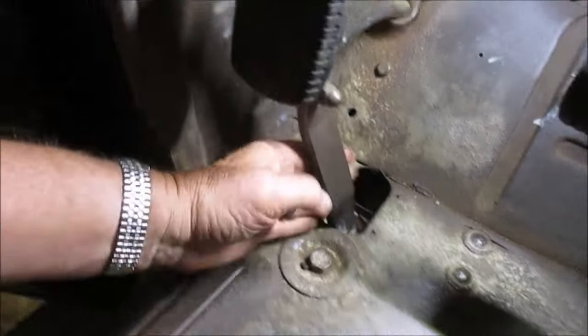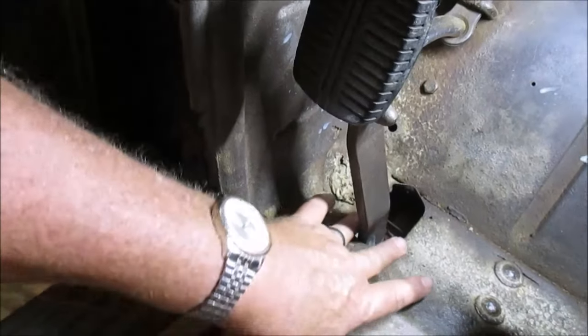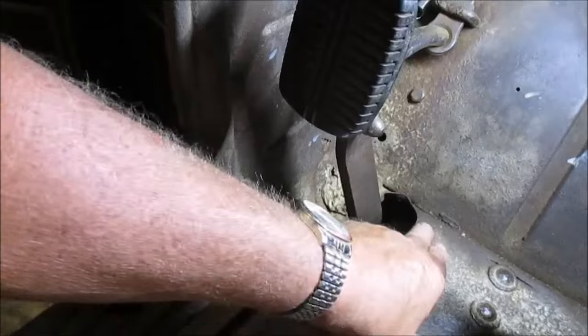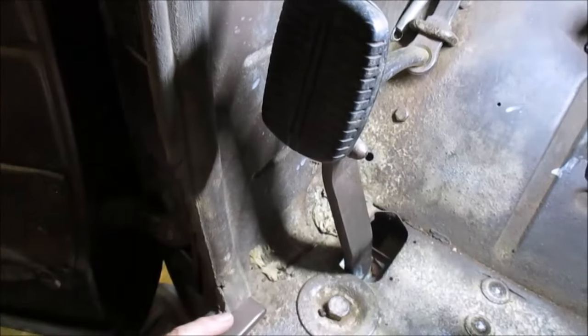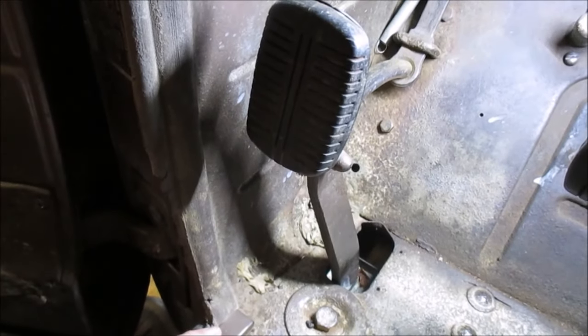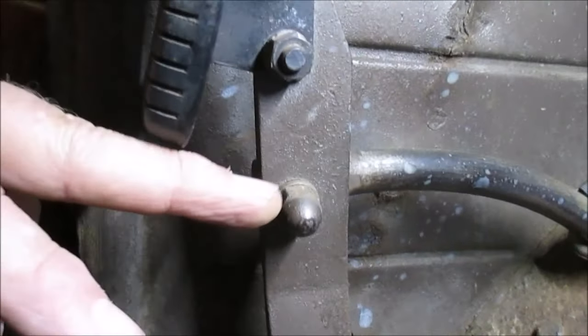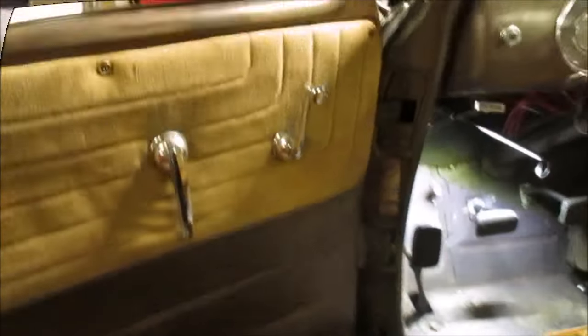Right here's what I'm talking about — you can see where the lever goes down through the floorboard. There's supposed to be a rubber boot that installs in there and a trim ring to keep it taut against the floor. You can see there are two holes here; there's supposed to be one up here somewhere too. It's long gone, so we're going to install a new aftermarket piece. To do it we've got to remove the pedal and disconnect the arm so we can slide it down the shaft.